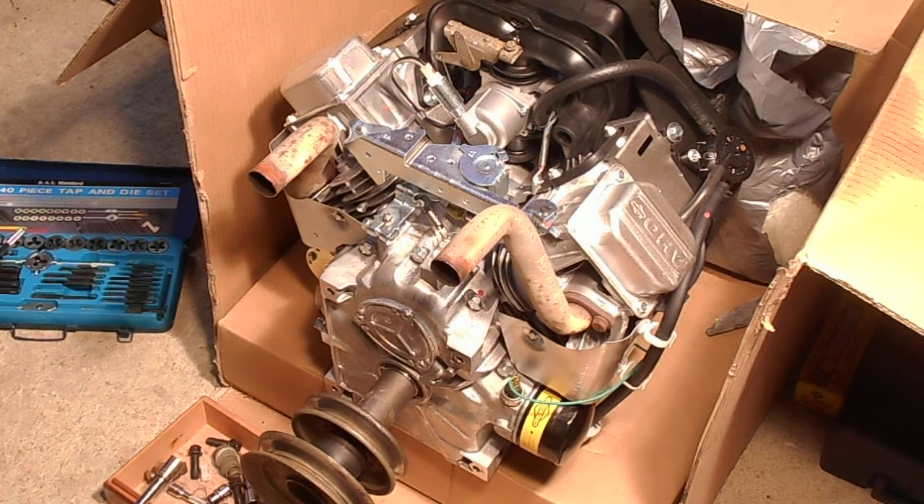This was a fight. Had to go to Raleigh last week to get the two gaskets to put in there, and they didn't line up — the holes where the bolts go through. So I had to stage it up with drill bits and drill out the holes where the bolts go through to actually get it to line up. But we got it. This is an aluminum head motor, so you don't want to strip them out — you can manhandle this thing and strip the threads out in a heartbeat.